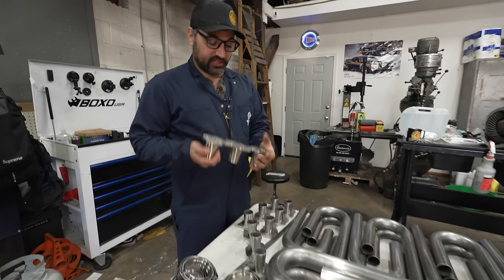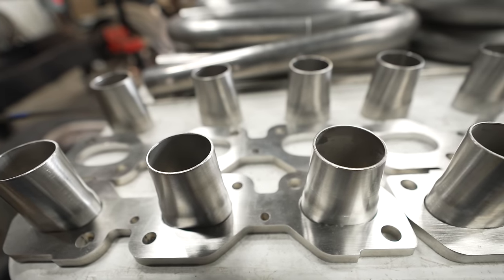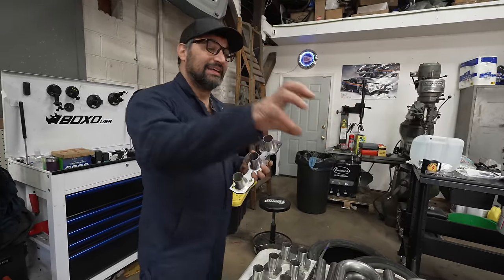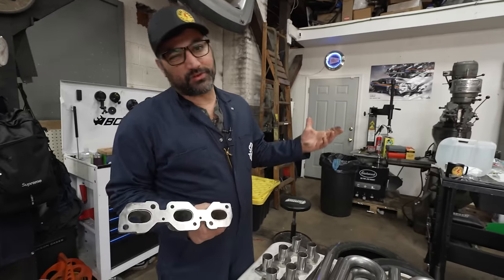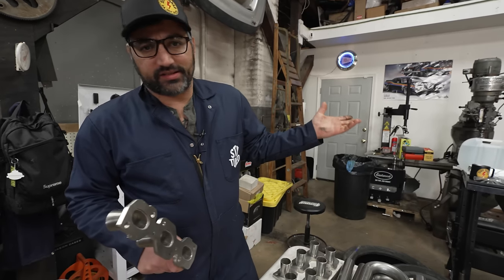And it starts right here with these flanges that they have, which are the same as a Duratec V6. So they have them for both. It's also a Mazda V6. You just need twice as many if you happen to have a V12, because this engine is heavily inspired by that 3-liter V6 that Ford used to make. They stole some parts from it, pistons, valves, most of the design.